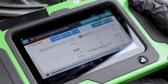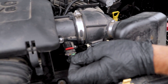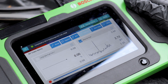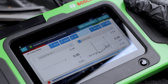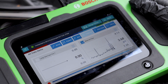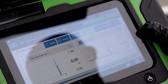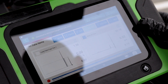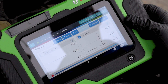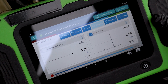What I'm going to do is just wiggle the wires and see if I get a spike. If I wiggle it just a little bit, just move the connector a little — there we go. That's not supposed to happen. There's a big spike. Just wiggling the connector is causing all these spikes and it's causing the engine to flare up and down.